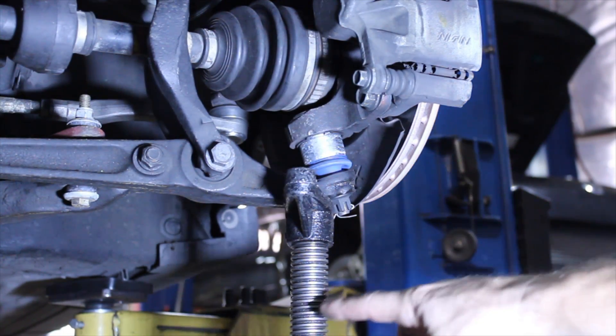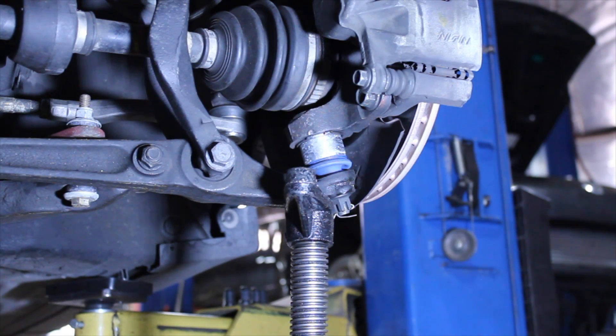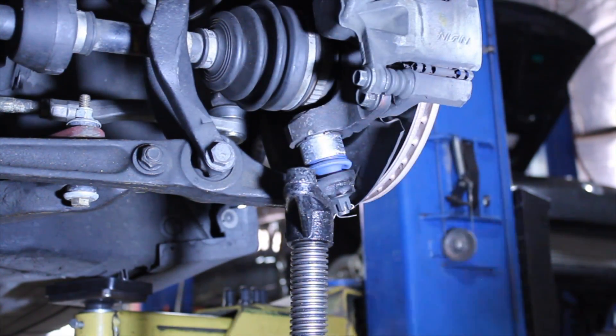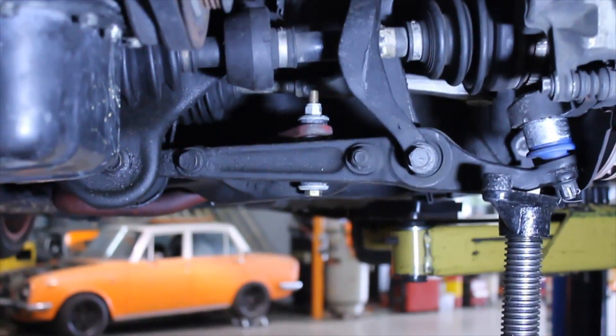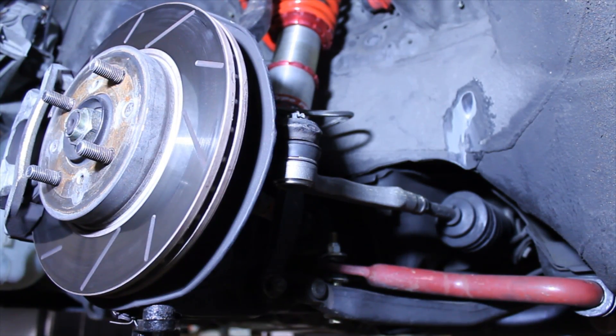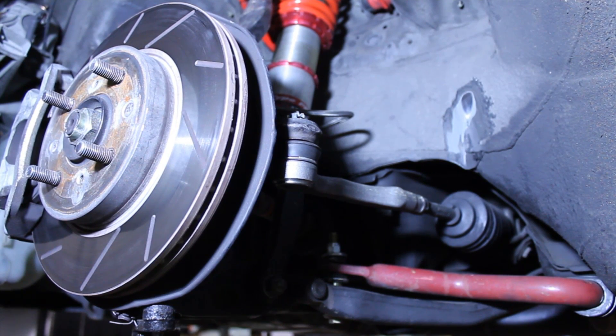Looking at the suspension you can tell I've got a spindle jack underneath the lower control arm. I'm actually loading it up trying to put it in the position the car would be sitting at rest to show the angle of the lower control arm and the angle of the tie rod. As you can see the lower control arm is flat, maybe slightly inverted. This is a guess on where this position would be because we're not on a drive-on rack, and then you can actually see the tie rod up there — and if you're a Honda guy you might realize that the tie rod is inverted.